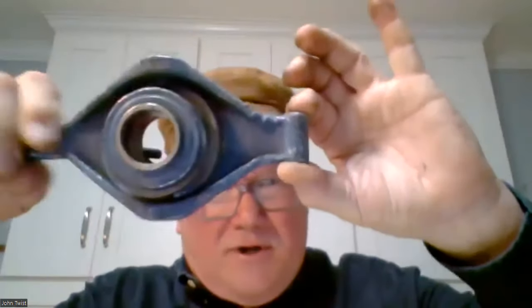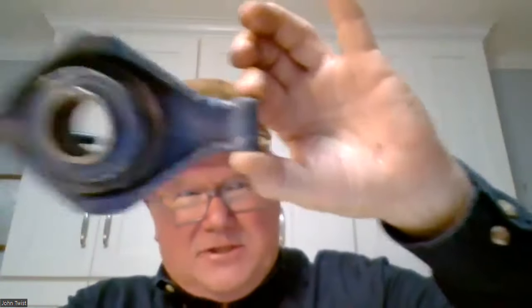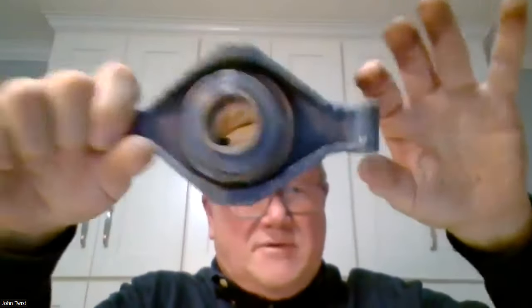The other thing, and this is a Midget 1500 release bearing fork, and it pivots over here on this side, and then the whole thing moves like this. And the pin, which goes over here, is held in with some little squiggly pieces of metal, and that drops out. Now this thing can free float, this pivot with a 5/16 hole in it. So we had bolts in the shop that were, I don't know, 6 inches long, something like that. You could reach up in there and drop that bolt down from the top. You didn't have to put a nut on the bottom because the bolt was never going to leave, and the bolt wasn't going to drop through because there's a head on the bolt. But we used to replace the pivot pin on the Midget 1500s. That was a trick that we did. But thanks for that comment.